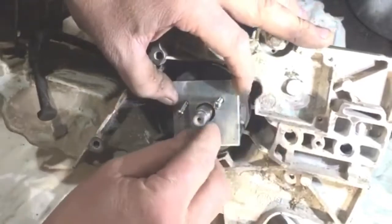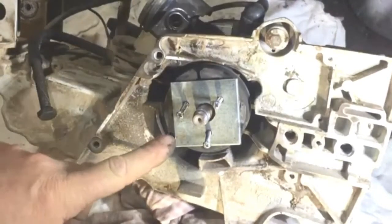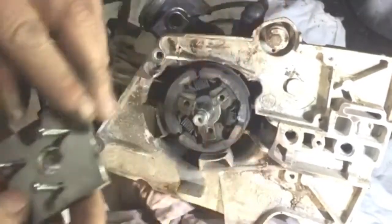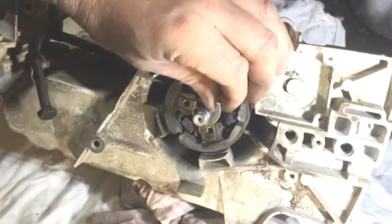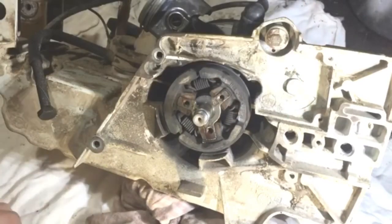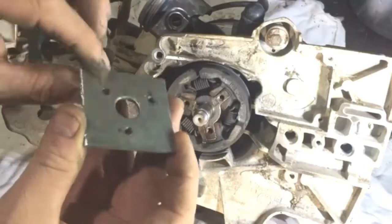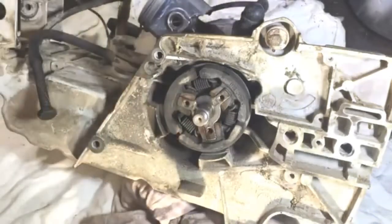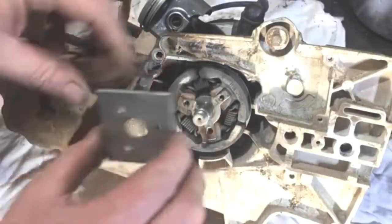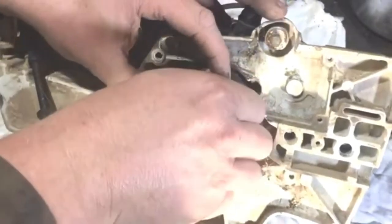All I've done - let me take that back off again so I can explain better. Initially all I did was got some screws with the same thread, put them in, and put a little bit of the black gasket stuff on them, then just pushed this square washer over the top to mark where I had to drill it. That worked quite well, and then I drilled it. I want to make sure they start okay because I don't want to cross-thread them.